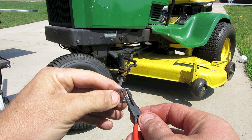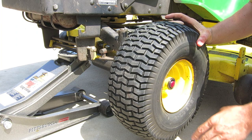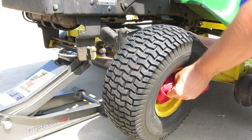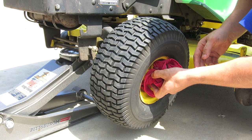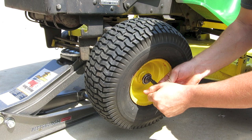If you don't have a lock ring tool, you can use small needle nose pliers — put the two ends in there and squeeze the opposite way to open up that lock ring. Have a rag ready because there is going to be a lot of grease that comes out as you put the wheel on. Hold that rag over the end of the bearing and just slide it right on, then wipe off all the excess grease. Now take the needle nose pliers, open up the lock ring and snap it right over the end.